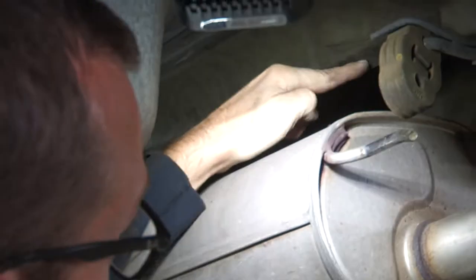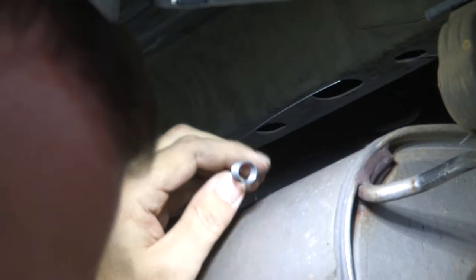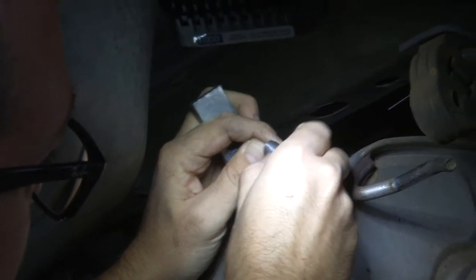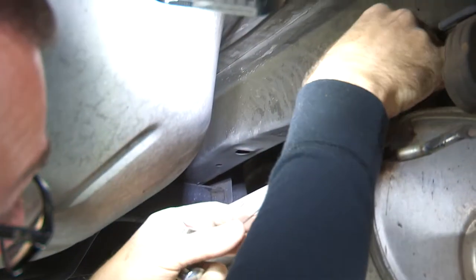These are our two holes on either side of the access hole where we're going to install our hardware. I'm going to first take the fish wire provided in the kit and lace it through the access hole and out of my intended bolt hole. Then I'm going to take that square punched plate, lace it onto my fish wire, and thread the bolt into the coiled section — that's going to retain all of this hardware. When I push the plate up and the bolt follows, I simply pull it down where it needs to be. For the remaining frame bolts, I'll repeat that same action with the fish wire, the plate, and the bolt.